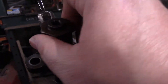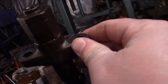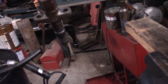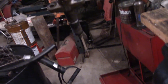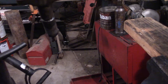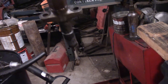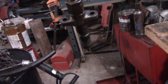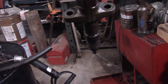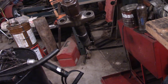We're also showing signs it's overflowing here, so you're getting a lot of bypass, which signifies a worn-out needle. And as I approach my pressure, it just leaks. Doesn't want to crackle. And even when I give it a hard squirt, it just sprays. So that needle seat is completely worn out — it's just not going to work.